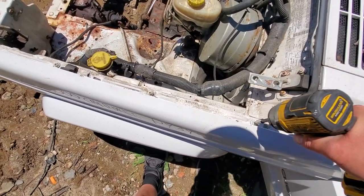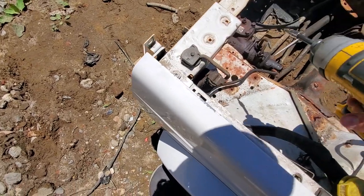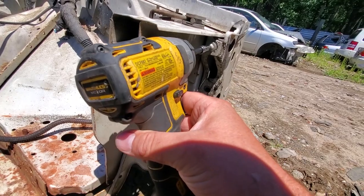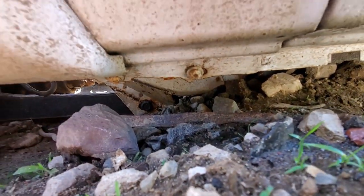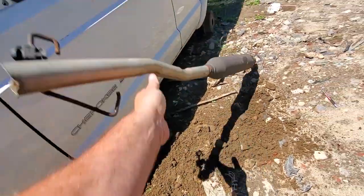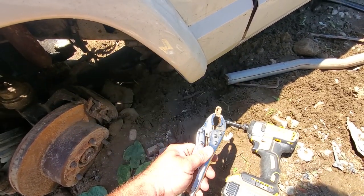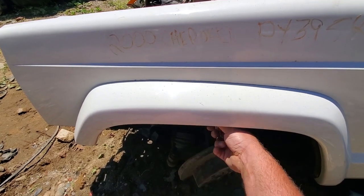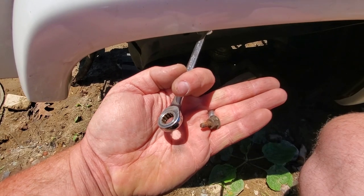Let's get this driver fender off. This one may be broken. I'm going to have to dig a hole to get these — I didn't even bring a shovel today. Dug a hole with that piece of muffler. The clip broke off so I had to get in there with vise grips in the hole I dug and still manage my impact on it, but got it. Don't forget that fender flare nut — that's attached to the brace. That one gets you every time, and it breaks every time.